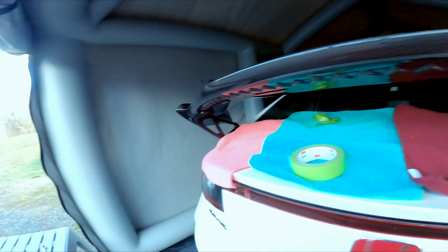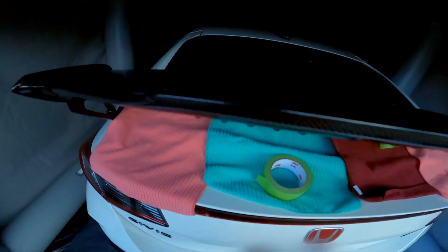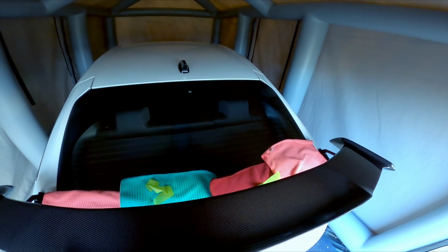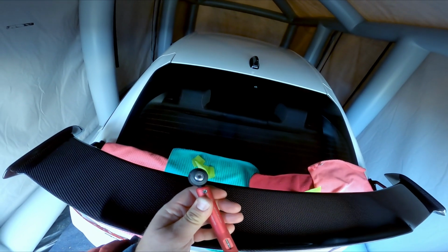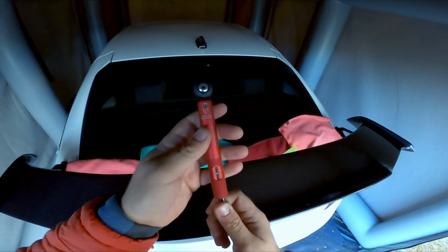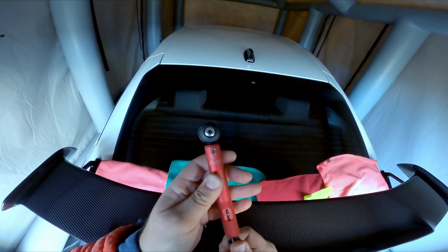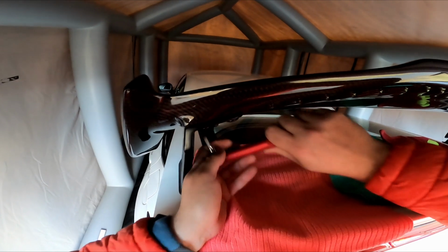And now we're going to torque it. I just set my torque wrench to 8.8 Newton meters or 6.5 foot-pounds, and we'll just torque down all 6 bolts. The order doesn't really matter. It doesn't say in the manual. So just do one side, do the other side. I will recommend a decent torque wrench in the description. Just torque them till they click, and you're done.